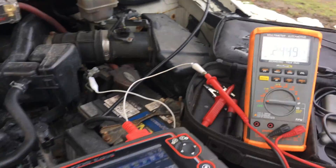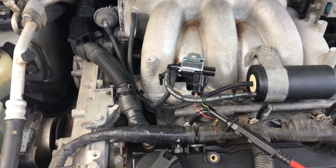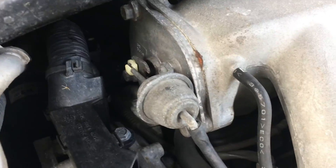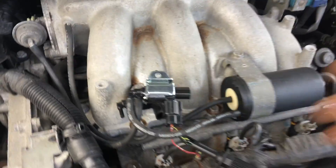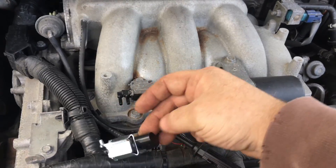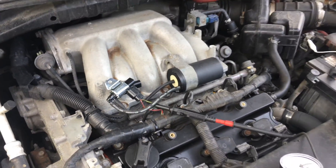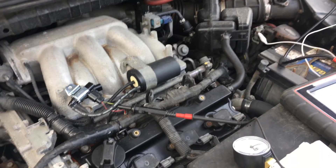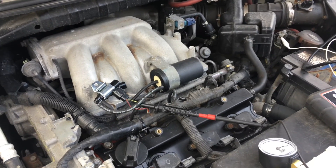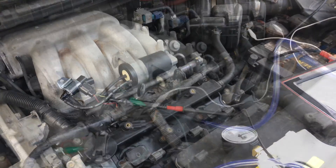So that was with the scan tool. What I found when troubleshooting was when I was trying to turn it on and off with the scan tool, this actuator was never moving. I decided I should replace this actuator — it was not very expensive, around $20 or less, some off-brand but the exact same part. The next section of the video I'll show you how you can test that solenoid yourself to see what it's doing electrically without a scan tool, just to see if that solenoid is any good.